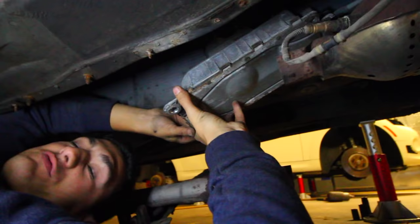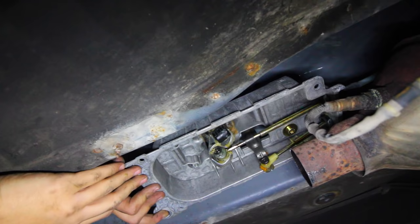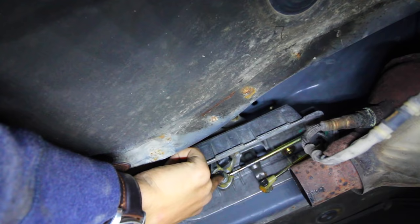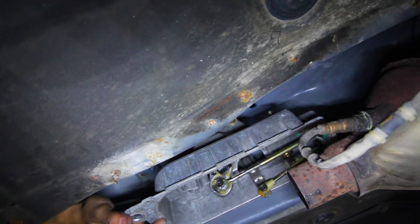So that is the inside — that's where our shifter mechanism and all that stuff is. From underneath the car we've removed the front plate that was covering everything. As you can see, we have two cables for our transmission — one on the left and one on the right — both attached to the shifter. We also have two bushings, one attached to each cable. We're going to disconnect everything, install our short shifter, and install the new bushings at the same time. The bushings we picked up from Diesel Geek — I'll have links in the description along with the shifter.